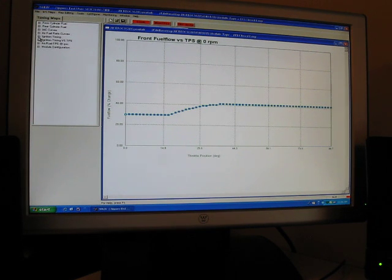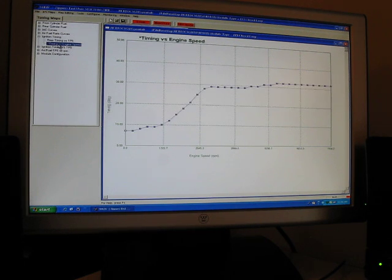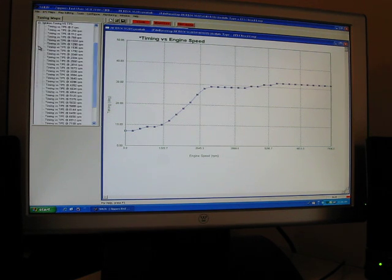We're going to start by opening the drop down of the ignition timing. The main area that we're going to be working in is timing versus engine speed. This particular map controls each individual timing versus TPS versus RPM map, two separate timing areas. If I make an adjustment on this map, it's going to affect one of these.